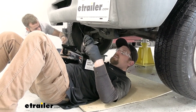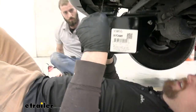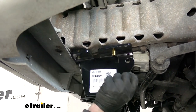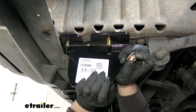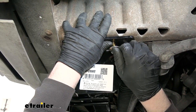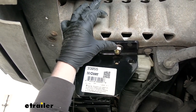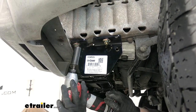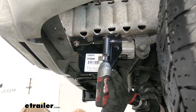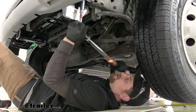With the help from Kevin, we're going to take our pull wires, feed them through the corresponding holes in the hitch, and raise it up into position. Hold it flat against the frame, then take a flange nut and get at least one started on each side so the hitch will support itself. Put the other flange nut on the other bolt, then come back with a three quarter inch or 19 millimeter socket and snug everything down. Once all the hardware is snug, don't forget to come back and torque it all down to the amount specified in the instructions.